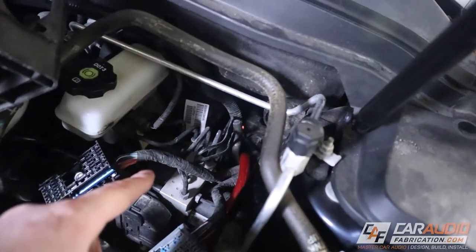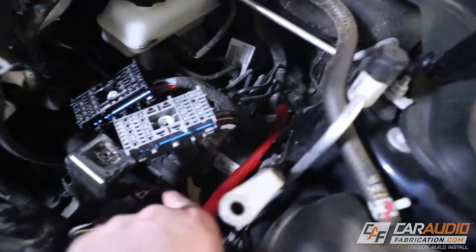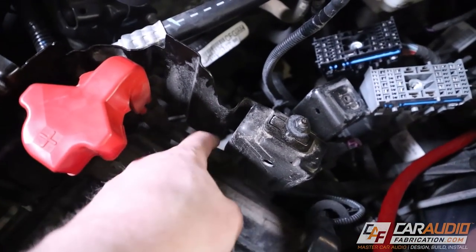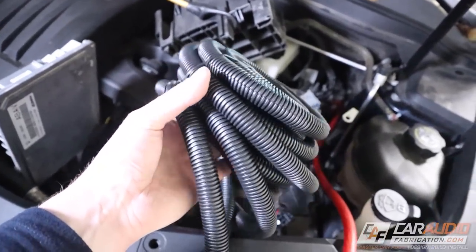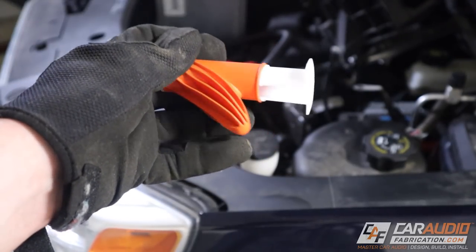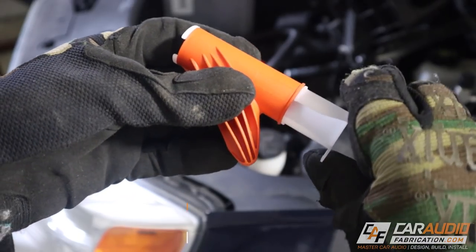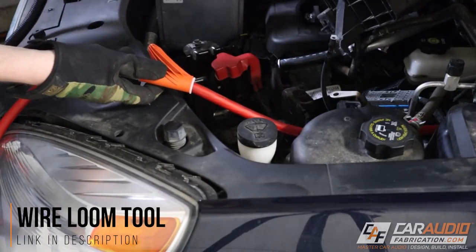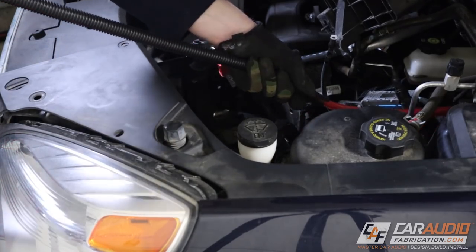I'm paying attention so that the wire isn't near anything that can move or anything that gets hot. I'm actually going to run it right along this factory harness that comes over here to the positive battery terminal, going through this same hole on the battery holding bracket. Since this is in the engine compartment, I want to put something more robust on it — I'm going to use this wire loom here. Applying wire loom can be somewhat of a pain, especially on longer runs of wire, unless you have this tool. I first open it up, insert the wire inside of it, turn that piece back in place, and then I can easily and quickly slide that loom right onto the wire.